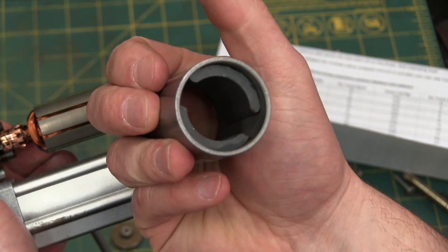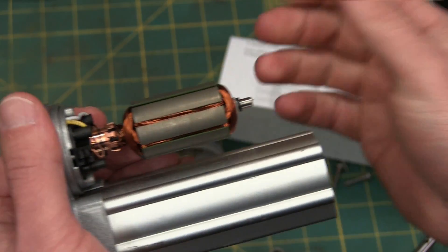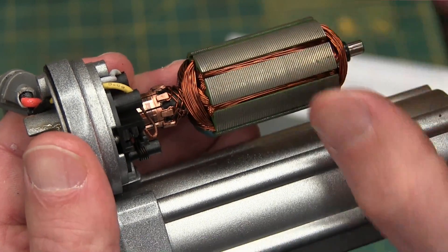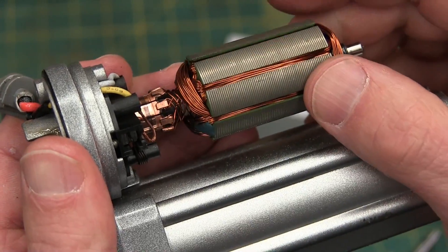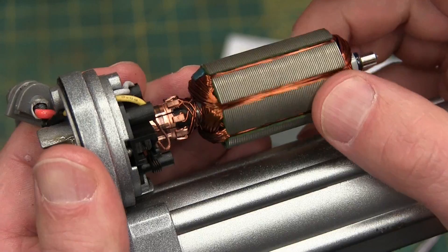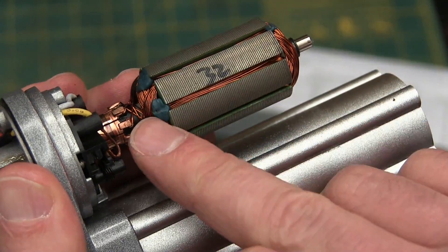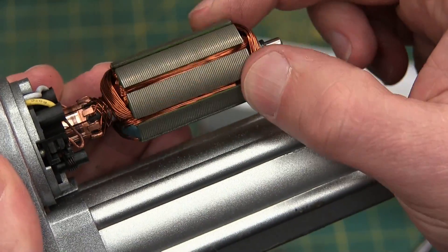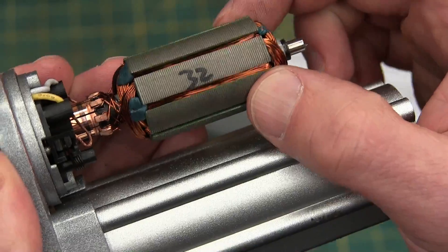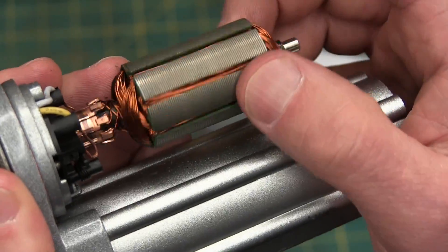Just pulled the magnet housing out — two-pole permanent magnet DC motor, brushed. And you can see how craptacularly that is built. See the magnet wire there? That's just crimped in, ends flopping in the breeze. That is why it fails when it sits around vibrating in a machine. And we can see epoxy balancing. That motor rotor armature is not going to last.